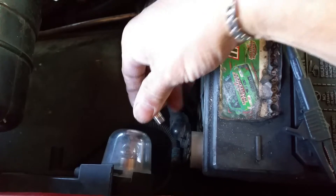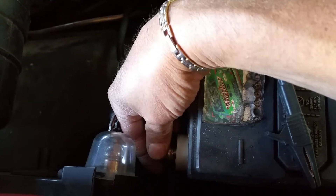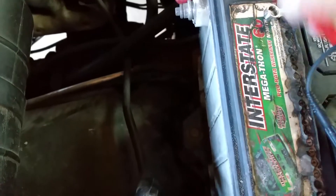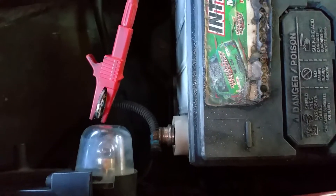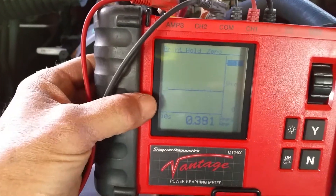I've got the little stud out. I'm going to take the wire off of the battery and get it out of my way. I'd like to put the stud right back in the battery so I've got a place to clip my multimeter to — finger tight is plenty good enough. We'll take the positive lead and hook it onto the cable itself, and we'll take the negative lead and hook it right onto the battery post. All the current that this vehicle is using is now going through this machine.